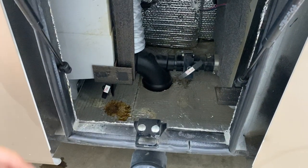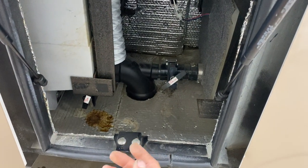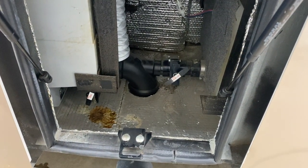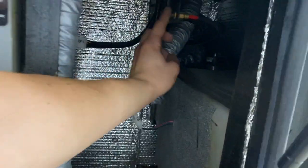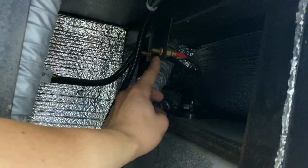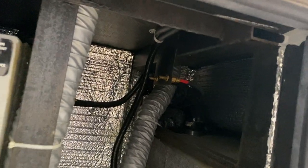Pull the black valve first — that's your toilet — drain that out completely, then go over to the grey valve and pull that last, just to help keep the hose a little bit cleaner. Right up top here you've got left and right little valves for pumping up your airbags in the bus, so if you're not happy with your ride quality you can adjust that with your air pressure.